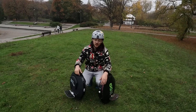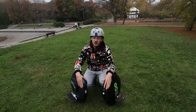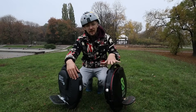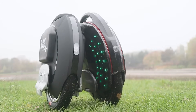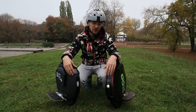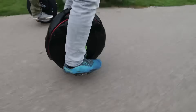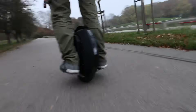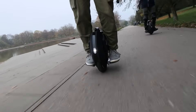Both of the wheels are 16-inch wheels, but the tires are a bit different. On the Kingsong we have a 16-inch by 2.125-inch tire, and on the V8 it's a 16-inch by 1.95-inch tire. The tire on the V8 is a bit thinner, which in my personal opinion results in more comfortable riding at higher speeds. But the Kingsong is a bit more nimble, has a bit more grip on turns, and overall also more grip when riding off-road.